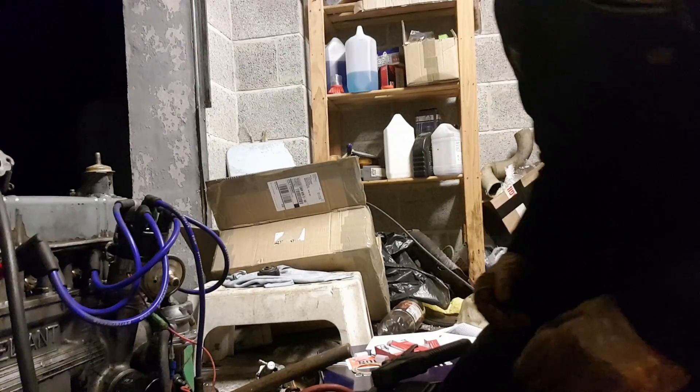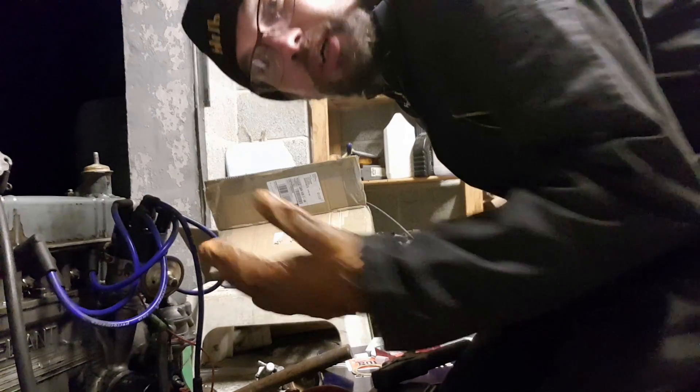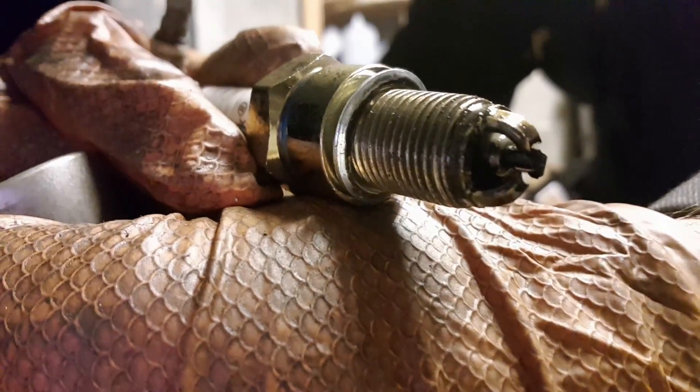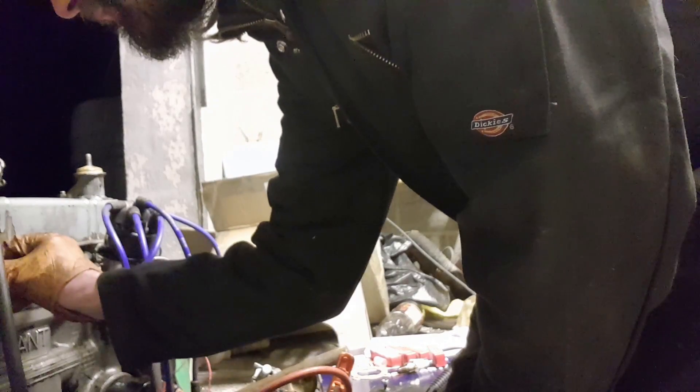We're back for another go and I've already found two of the spark plug leads were the wrong way round. So I was seeing spark but it wasn't happening at the right time. We'll have another go. Yeah, definitely counts as flooded. The plugs are quite soggy. Now bang the old plugs in — we'll have a look at those instead. They annoyingly use a different size of socket.